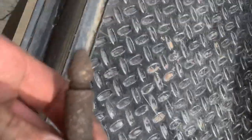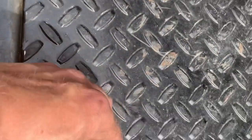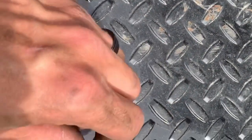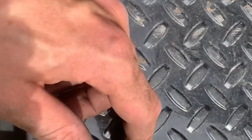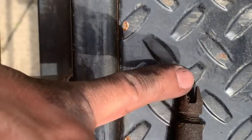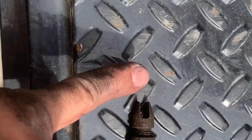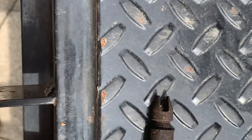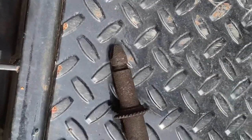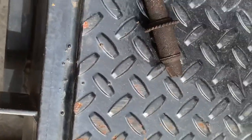I found an old star adjuster — it's rusted, but that's kind of the point: the same thing is going on inside those brakes. When you've got the screwdriver in there working it and spinning, if it's rusted it won't move easily. But that's what's pushing those shoes out, making the adjuster longer, pushing the shoes against the drum. They do automatically adjust, but on these trailers they work so hard and fast that they're just not adjusting fast enough.